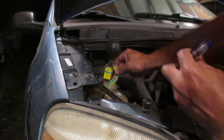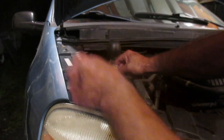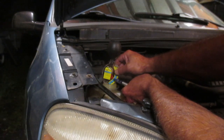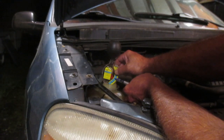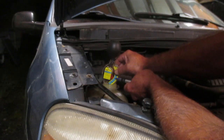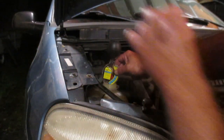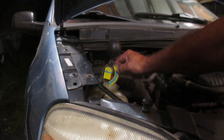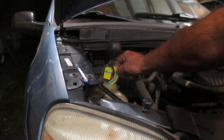It's a fairly cool evening here in Canada, so I wanted to let the vehicle run long enough for the thermostat to kick in and really circulate the coolant. I've just shut it down. We can see that even at this point our reading is up to around minus 22 degrees Celsius, just from the coolant flowing around a bit. If I were to take it on the highway and let the thermostat fully kick in, we'd get a more accurate reading. But I think this shows you how the hydrometer works. Thanks for watching, and I hope this was helpful.